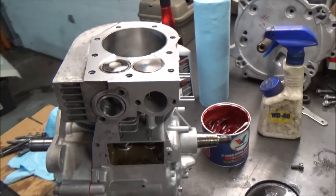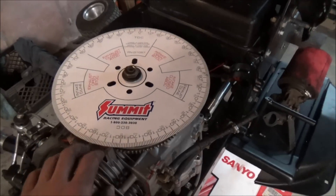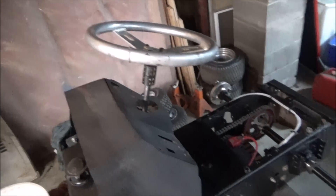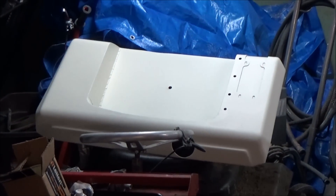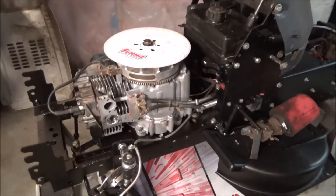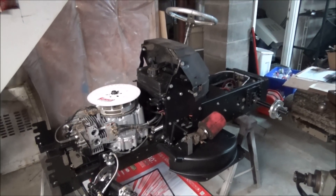I'm going to do the timing on it and everything — try to do it right. I've got the timing wheel on here set up; I gotta get into that pretty soon. I called the cam manufacturer to get the degree — they say 30 degrees advance, pretty much what they run. I want to get a 14-inch cart steering wheel; I have one on my other mower over there. The body panels are just primed and they came out pretty bad — I'm going to sand them down. Still need to finish up the body panels, do some paint, set the motor up, time it, get it all tuned up, probably bore out a carb, and set up the brakes.